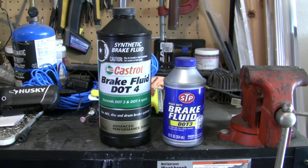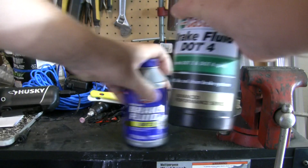In order to have that even press, how would you do that with a cable? Some people did design cable-operated disc systems, but they were really unreliable and didn't work very well. So smart engineers said the way to press evenly would be to have a fluid do the pressing rather than pulling with a cable — and so we come to the fluid.